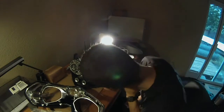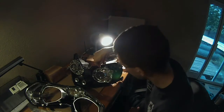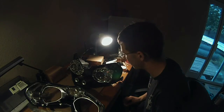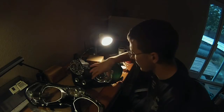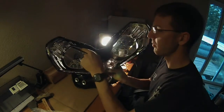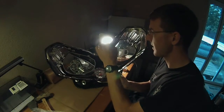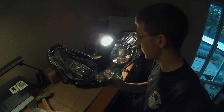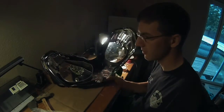I've run into a couple of clearance issues. One I'm not going to take care of right now; the other I will. The first is up in the cup — the shroud is slightly touching on either side, but since I plan on pulling this back apart I'm going to leave it until I can get some new shrouds and modify them before putting them on. There's also a slight clearance issue with this top balance right here. My first try is going to be to heat it up and bend it up ever so slightly since there's enough room. If that doesn't work I'll take a pair of nippers and trim that back since nobody's going to see it anyway.